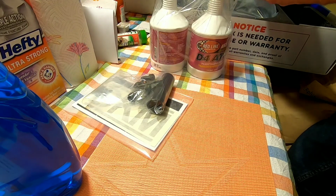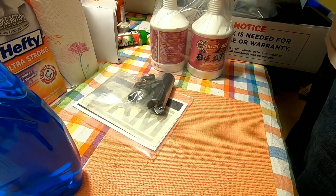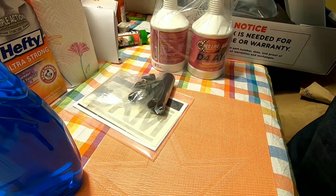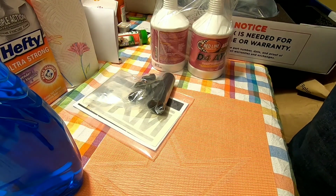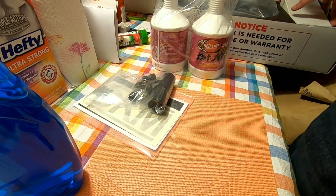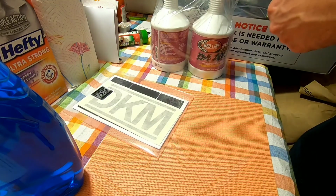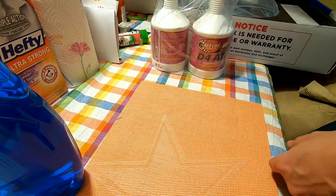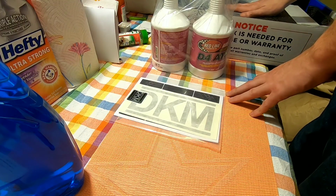Yeah, so this clutch is like $1,600 something dollars. Was it 800 torque? Like 675 torque. 675 torque. So, Stage 3 DKM. It is one of the lower stages for the twin disc, but that's its torque rating. And I don't think we're around 650 torque. So we should be pretty Gucci and even have some room to turn the car up after we get a turbo better suited for making it into a drift car.